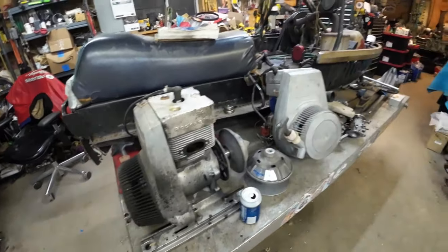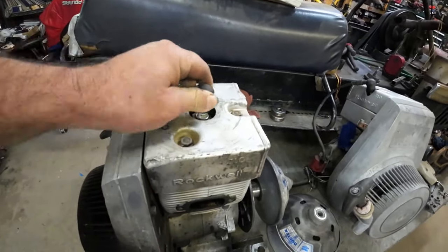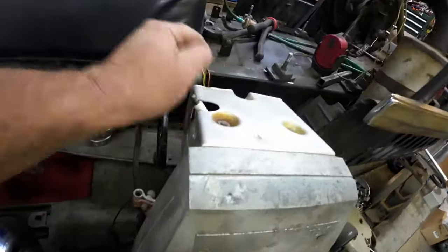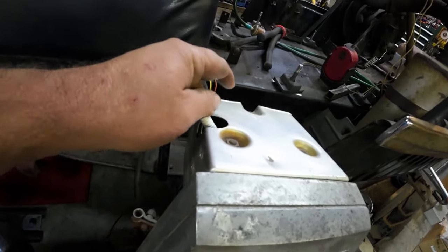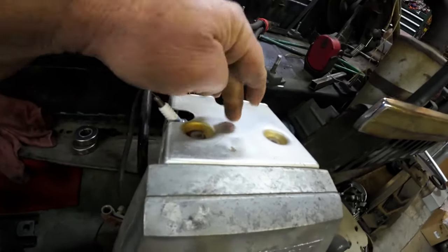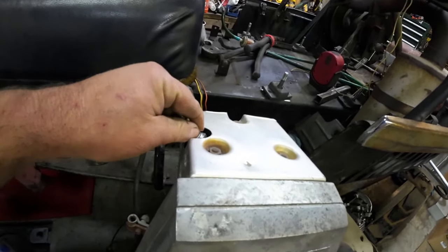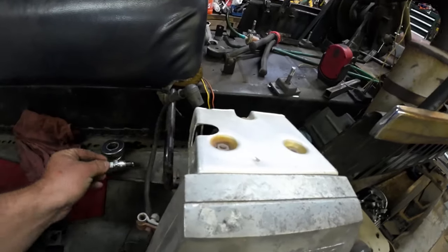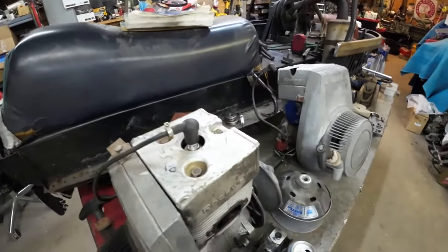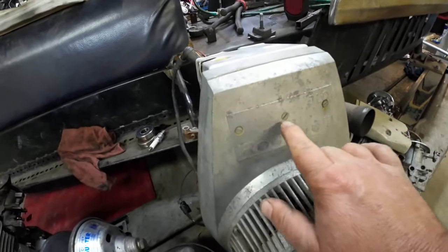Let's start with the differences between these motors. The most obvious one: the old L295 has a big 18mm spark plug right in the middle of the head pointing straight up, and the R has a 14mm plug — I think a BR90S works — angled on the head. You can see where the L cutout would be; there's no cutout there, it's moved. So that's your basic BR9 solid core. That's the obvious difference when you're walking up to one of these to tell them apart.